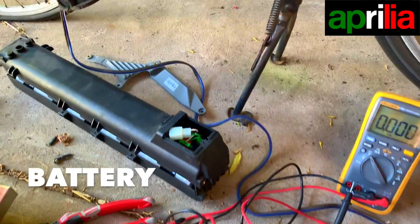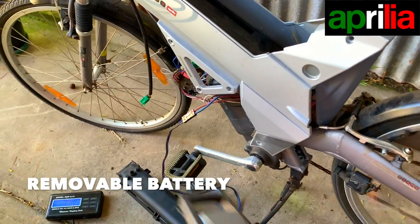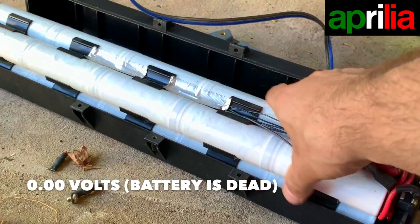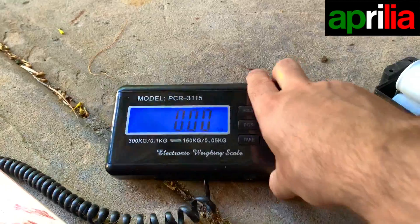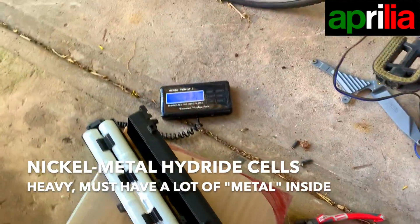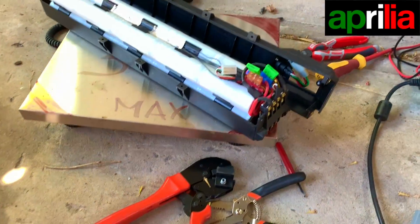The battery in this bike — let me just turn it down, it's a bit too noisy. So the battery is actually fitted here in this spot. This thing is actually a removable battery — zero volts, of course. Look at the cells here, they're massive and so heavy. It's gotta be the heaviest battery. This is actually nickel metal hydride batteries. So this is zero kilos — I'm gonna put the battery here. So it's six kilos, just here in a 25-volt little battery.